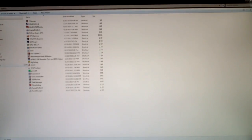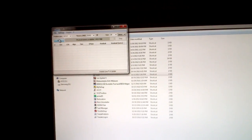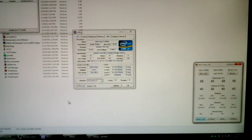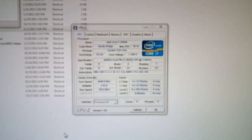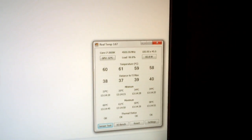If you really want to see what your overclock can do, I suggest downloading Linpack and then running that with CPU-Z and RealTemp open. What that is going to show me is under a heavy load — Linpack is like the heaviest load I can imagine putting on a PC. It's going to show me what my peak voltage is and also what my load temps are.